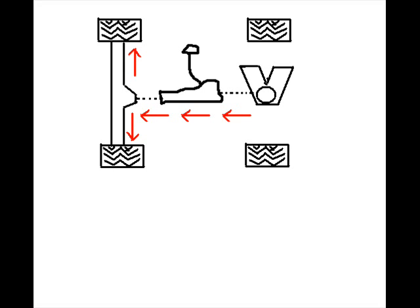The normal movement of this car is that power passes from the motor via rotational force to the transmission and is either geared up or down, depending on the gear, and on to the differential, which almost always gears this rotational force down and applies the force to the tires, where it is converted into forward movement.